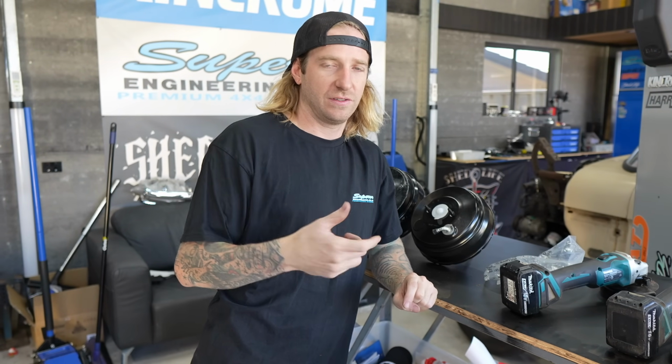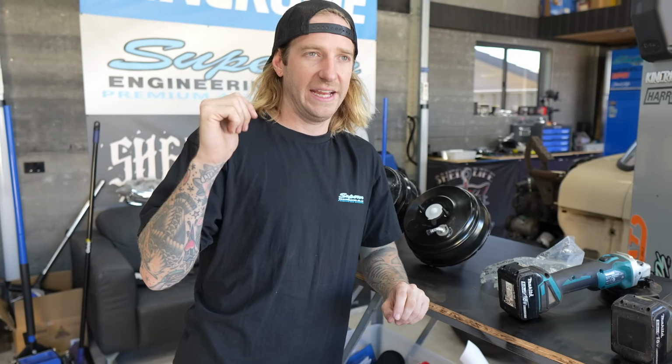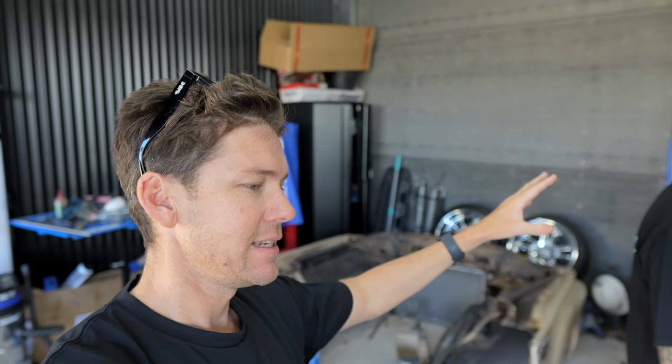In my C10, the engine didn't produce enough vacuum to pull in the brake booster. I installed what you guys are about to see me do on TJ's. It's basically an electric vacuum pump, so it runs off the battery, not the engine. It creates vacuum, pulls the booster in, has a check valve, and a pressure switch. The idea is even if the car stalls, which is unlikely as it's an automatic, even on a badass hill you have full brakes until the battery goes flat. That should give you enough time to get out of there.